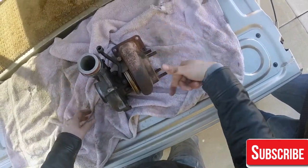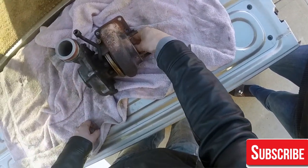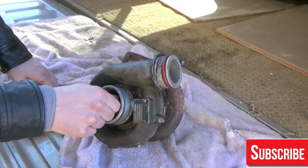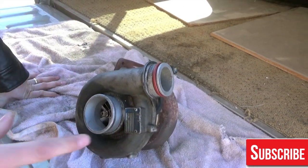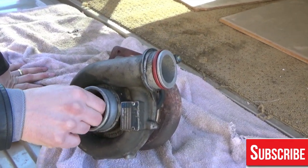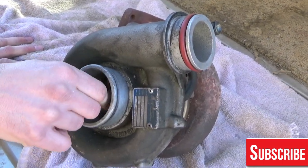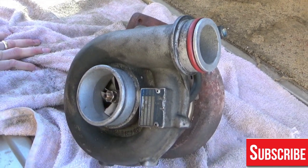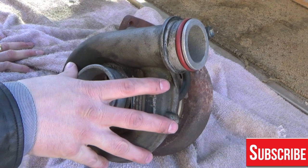Exhaust gases flow through the exhaust system and get this wheel turning. That's where it starts. Of course, it's lubricated in the middle. Then on the compressor side, the cold side, it's taking fresh intake air from your air filter. Because this is on a common shaft, the compressed air goes into the intake manifold, creating a compressor situation and additional pressure in the intake manifold, which therefore adds power. You can't deny power. That's how a turbocharger works.